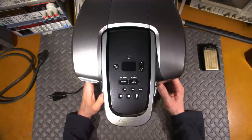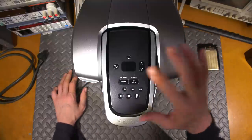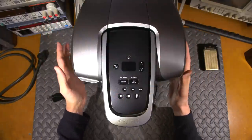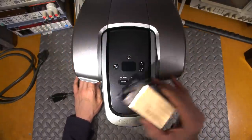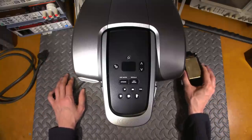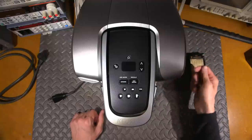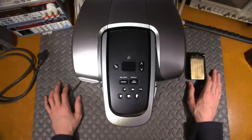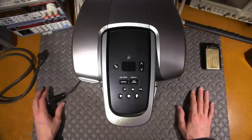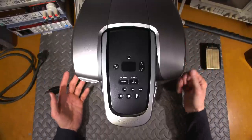That's what I mean by RF fire hose - it's everywhere all over the HF bands with a lot of harmonic content. Now the other Keurig coffee makers I have don't do this at all - they're the exact same model. I can go right up close to those and it makes just a touch of noise, standard switch-mode stuff. So this one here is a little out of hand. I'd just unplug it, walk across the place, unplug the thing, and my sensitive radio hearing is back.